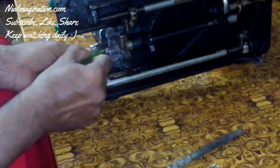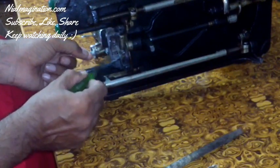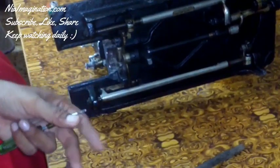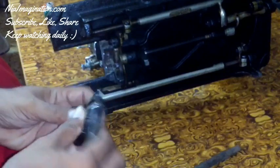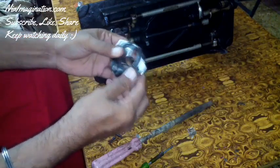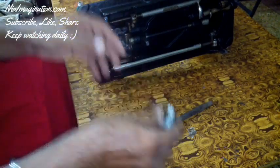You can see there is lots of dust here. Whenever you are sewing canvas, buckram, or any cloth, this type of dust gets stuck in your sewing machine. You have to clean your sewing machine at least every one to two months, because this dust accumulates and causes problems.